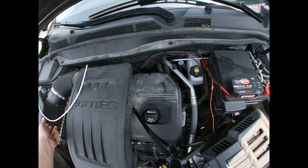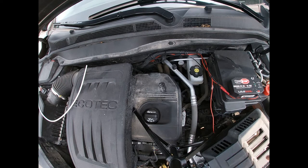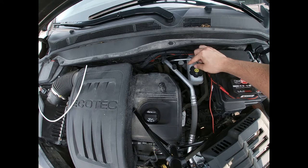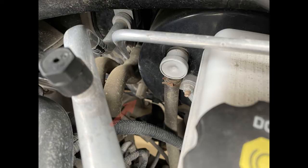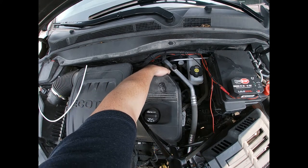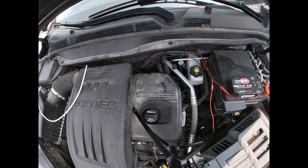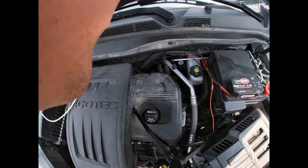The straw goes on the top of it to put into the drain tube. The drain tube is located down in here — I got a few close-up pictures to assist you because I can't get the camera in there while I'm reaching in for it. If you look at these, there are two tubes going right here; it's just directly under those two tubes, so you may have to actually climb up onto your hood to get to it.